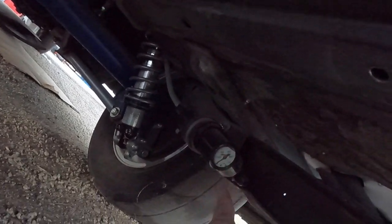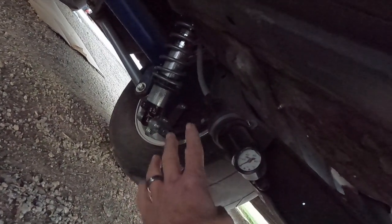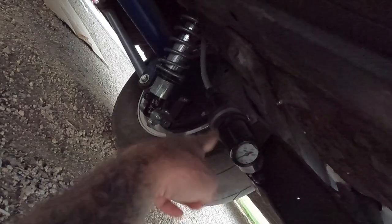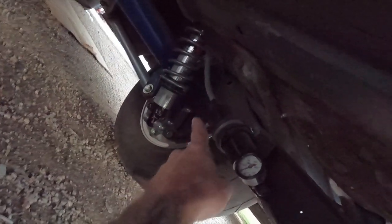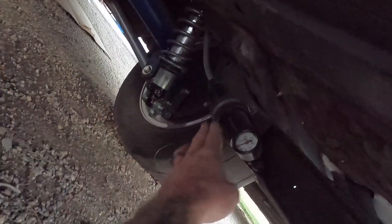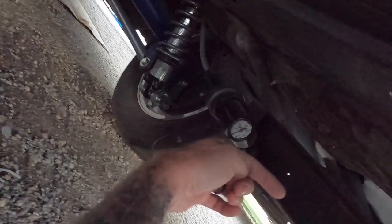Here's the hole in my trunk where the line comes out, and there is the filter. I've got my pressure gauge here — I have a lot of fueling issues so this lets me know if the filter is plugged. This will read higher than my regulator because you lose a little pressure over the run length of the line. With a fresh filter I fire it up, note it reads a few PSI higher back here, and mark it. When that reading goes up, I know the filter is dirty without guessing. We'll leave this in — I've got the sock filter pre and post, plus the socks in the tank, and that should suffice.